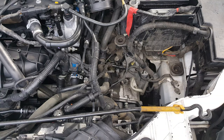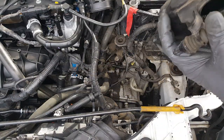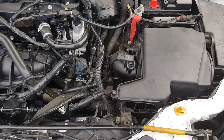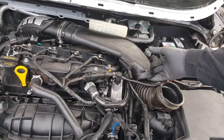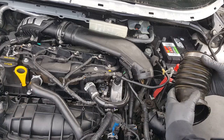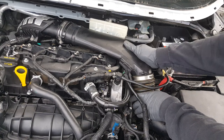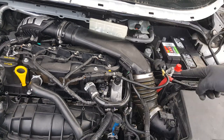We're just going to reset the air box - just got our rubber grommets that these are going to set into down here. I had to take that air boot off a minute - it's just not enough room. I'm going to take this back loose and free this whole thing up so I can get that piece in. I just loosened that band and took this back loose. It came out easy but going back in was a little different. Let me just reconnect this and tighten both of those up.